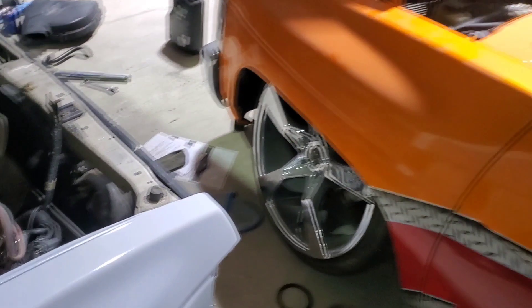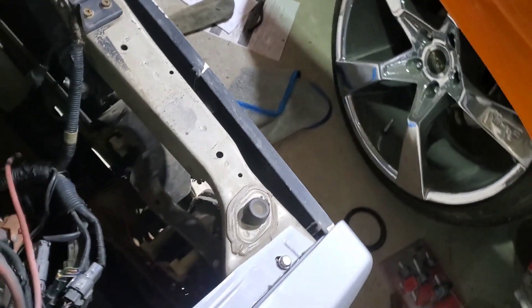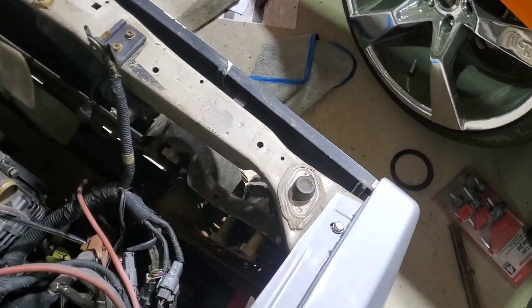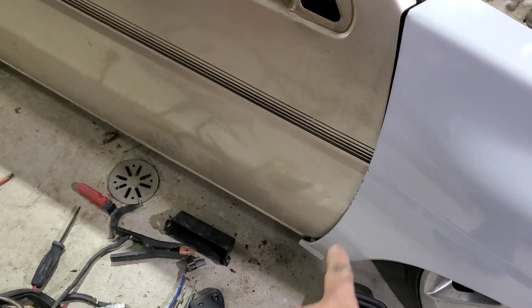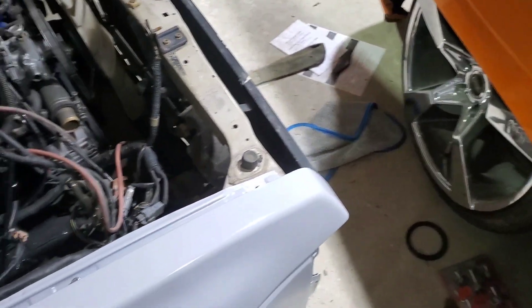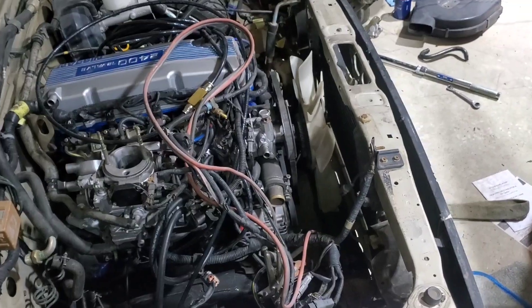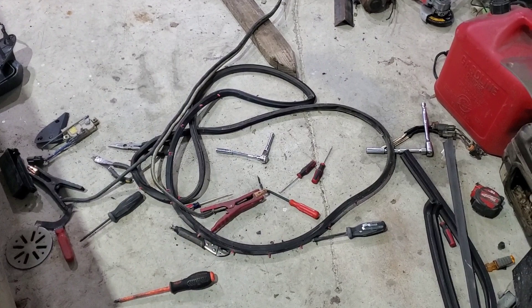I think maybe when I did the Z-notch on the front that might have dropped down a little bit too low — I've got the bushings pulled out. With the bushing out it's sitting way lower than it needs to be, but if I pull this up it helps the fender line up back here, so it's not really that bad. I'll just have to get the right bushing and all of that fixed. Actually if this is raised up a quarter inch higher I will clear this hood better with the engine, so that'll be good. I'm going to go ahead and label the glass and the seals so I don't get anything mixed up.